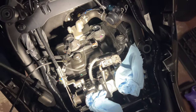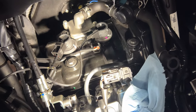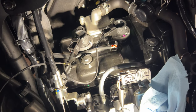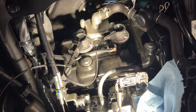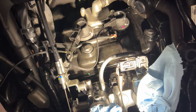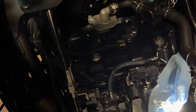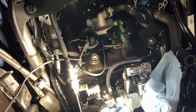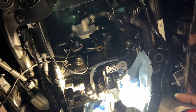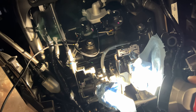This is what it will basically look like once you get the engine loom finished and set up. You can see it's just plugged in line — the OEM connectors are really good and the Anitori connectors are also really good. They connect with a positive click, so make sure you hear that to confirm everything is plugged in properly. You're going to have two connections that turn into four connections that plug the Anitori in line. Make sure you route the wires to the side in a way that you're not going to have any tension on them, because that's really important, especially with these connectors. The way you zip tie them is also important — you don't want any tension that could cause problems in the future.